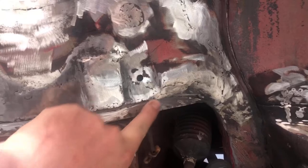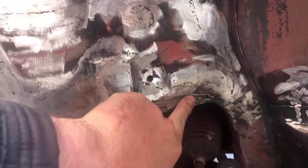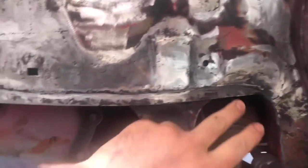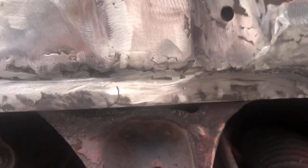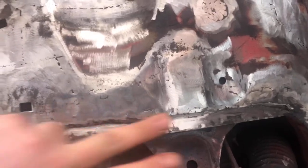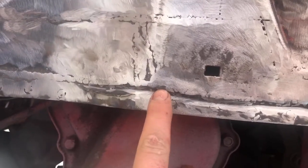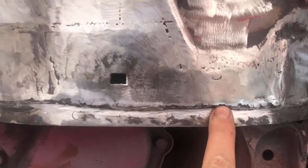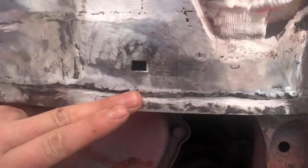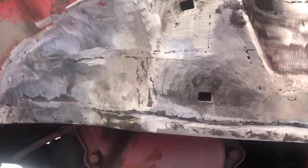I've just knocked all the weld off and it's come out better than I ever could have asked for — it's absolutely bang on. A little bit of filler and it'll smooth everything out. The only thing is the weld doesn't tuck in some places — I think it's because it was only cold when I was tacking it. Once you get a bit of heat in it, it does weld better. I need to fix some of these and then it'll be ready for a skim. I thought I'd just show you after my first weld and knocking it off with a flapper disc how well it's actually turned out.